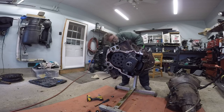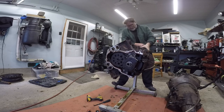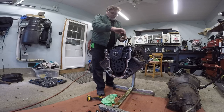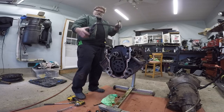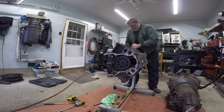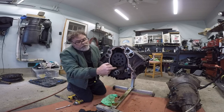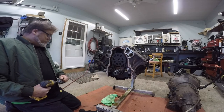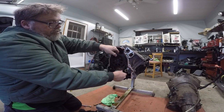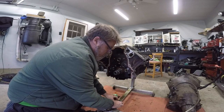Oh dicks - I forgot these are just sitting in there. You've ever seen a block that uses standard and metric? It's kind of goofy. All right so now that should slide off - there we go, there's the oil pump for an LS. Now that's all done we can roll it back around. So now we're going to try to find the lineup at the bottom. There we go. So when you're doing this make sure these two dots line up together because if they don't you'll cock yourself right over - big time. But as you can see the timing chain is mint. So we take this off like that and pull it off and that's all there is to taking the camshaft out. We're ready for a camshaft swap.